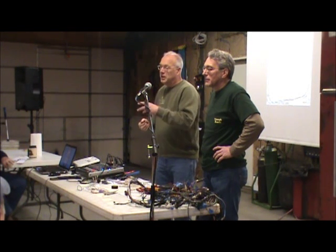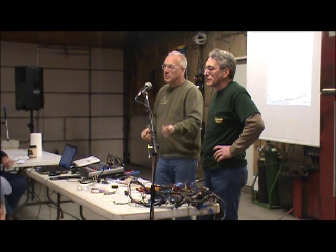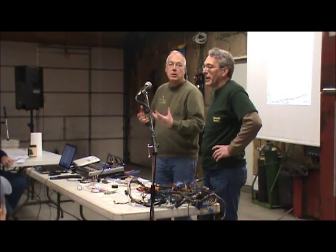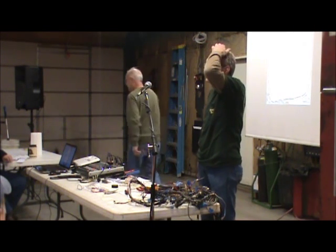We try to use the correct wire depending on what we're doing, but if you use a brown wire from the alternator to the battery, that'll drain off some. You'll give a better path back. You'll be charging the battery directly as opposed to through the harness.